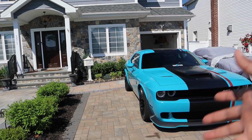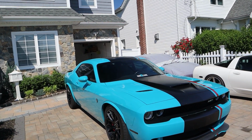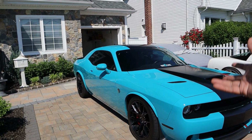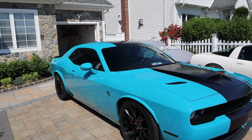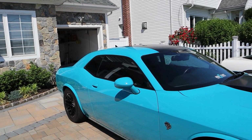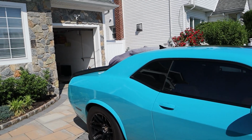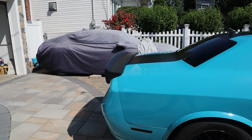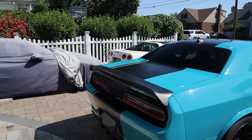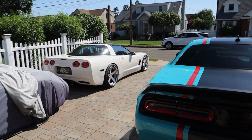Usually I'm driving around on my street settings, which is about 19 pounds of boost. It's my setting 2, as I call it. It's my medium boost, and the car is somewhere in the mid 11s on that. But for this event, we're gonna go with an additional 6 pounds of boost on top of that. Really, really send it. You guys do the math. The car probably makes about, per pound of boost, another 20 to 25 wheel horsepower. So there you go. You guys do the math.